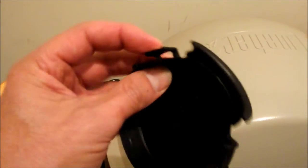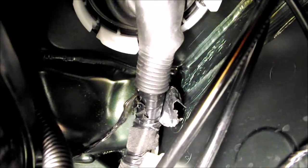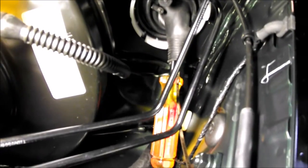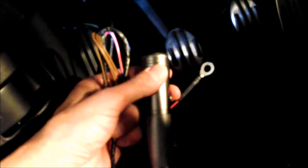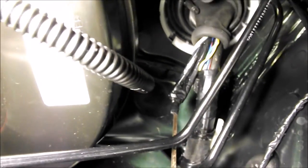For this cap, you need to pry up the far side to get it to unlatch. I used a knife and cut away the electrical tape at the end, which I'll replace once I've routed the wire through this conduit. With help from a screwdriver I stuffed it into that grommet, and then I was able to get the fish tape in there so I can reach it from the inside. I connected it about halfway through the harness and pulled the harness through.